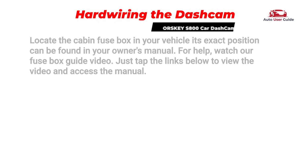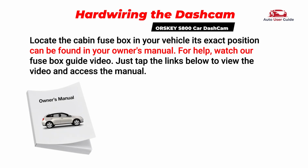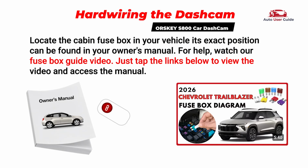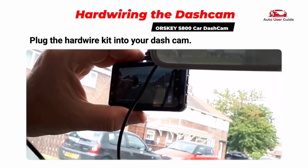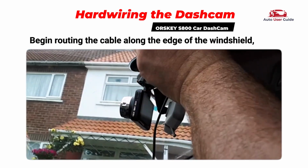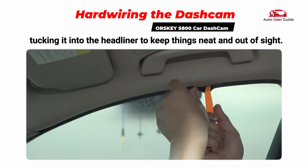Hardwiring the dash cam. Locate the cabin fuse box in your vehicle. Its exact position can be found in your owner's manual. For help, watch our fuse box guide video. Just tap the links below to view the video and access the manual. Plug the hardwire kit into your dash cam. Begin routing the cable along the edge of the windshield, tucking it into the headliner to keep things neat and out of sight.